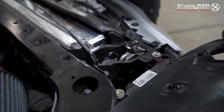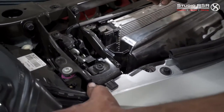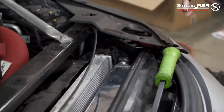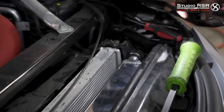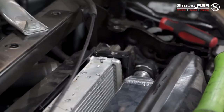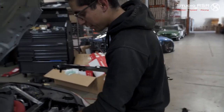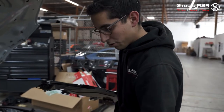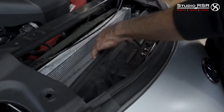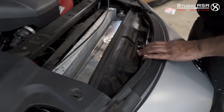The fitment is great. It slides right into the OEM pockets on the side. You can tell they created a little triangle to make sure it fits perfectly on both sides. The end tanks line up perfectly where the OEM one is — no fidgeting, no stretching, nothing. Everything just fits right where OEM. Now that we have the CSF heat exchanger in, we have the transmission cooler mounted to it down there. It's mounted to the heat exchanger itself.